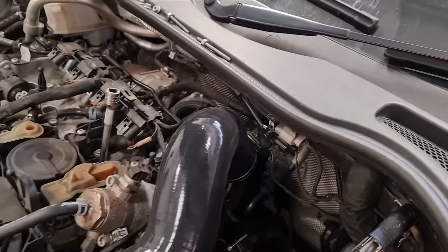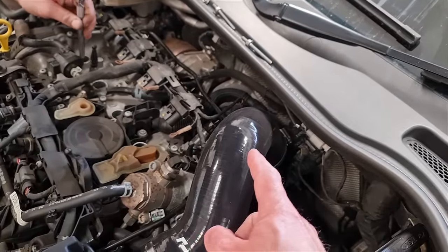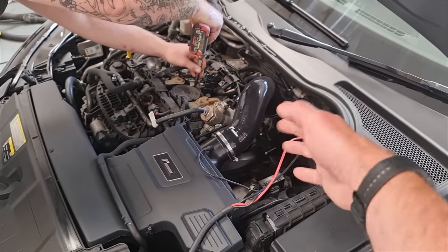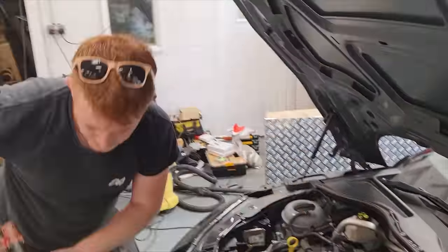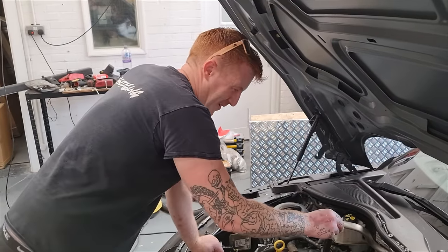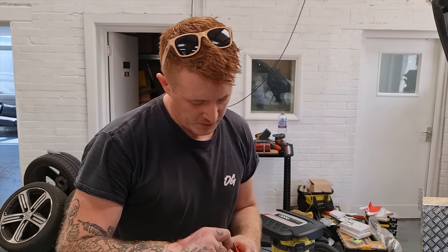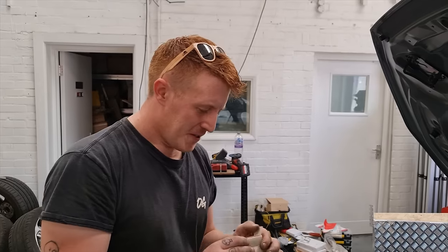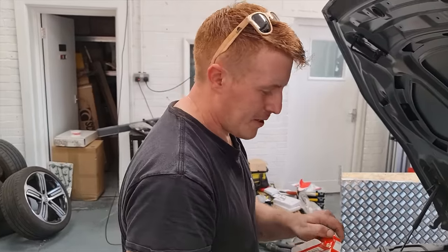Plugs are going in. I made a bit of a mistake - I was going to get the turbo techniques pipe which had the turbo elbow built into it, but I ended up ordering the normal racing line pipe which hasn't got the turbo elbow. Ben reckons it won't matter too much, might get away with it. What's the reason for the uprated plugs? It's a colder plug - when you start chucking higher boost pressures, you drop the heat range down.